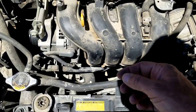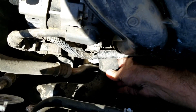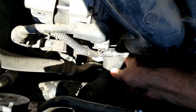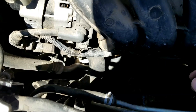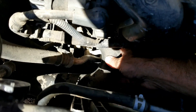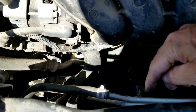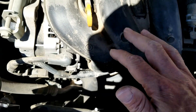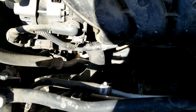If it is stuck closed, what you can do is feel these hoses — there won't be any coolant flowing past them. The engine is going to have to be warmed up when you're doing this so that thermostat does open. That's the reason why I'm saying not to do this, because this can be hot down in here. These hoses can get hot, and you're also going to be near fans and a hot intake manifold. That's the reason why I don't recommend this method.